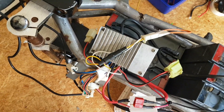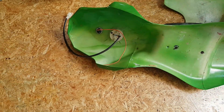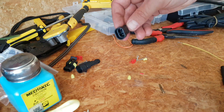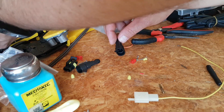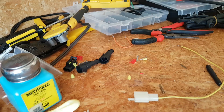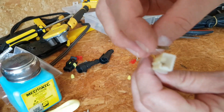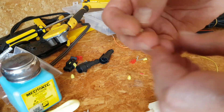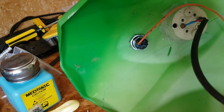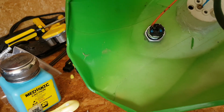I think the next thing I might tackle is this ignition switch, and the other half is on there. So I gave up on re-crimping it — it's just going to take too long, too much work, too much effort. I just pulled it out with little micro pliers, pushed a screwdriver in there and pulled it out. Held it with my little pliers and opened it up. We'll re-crimp that into it — that's the other side there. Going to re-solder that, put some shrink wrap over it.